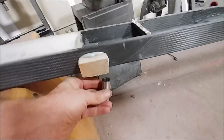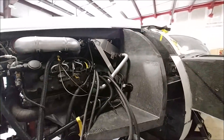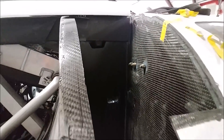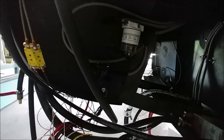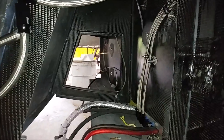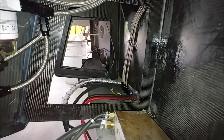Here's a close-up look at the engine mounted to the firewall. A lot of things are still just sitting in place — the radiator and the intercooler above it need holes drilled to mount them properly. The heat exchanger at the bottom isn't going to live there; it's actually going to live up above. Dan's already got the fuel filter and one of the fuel pumps installed, some fuel lines already run, and the battery cables and heater cables are done.